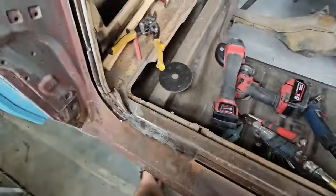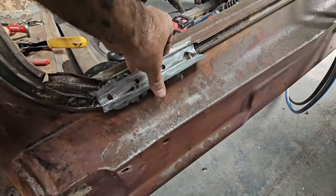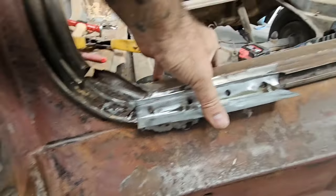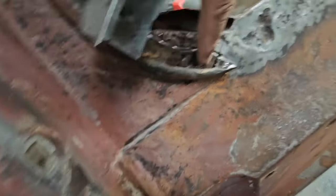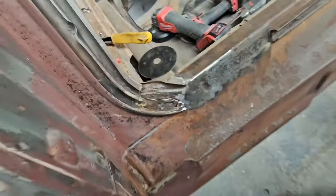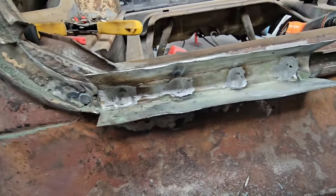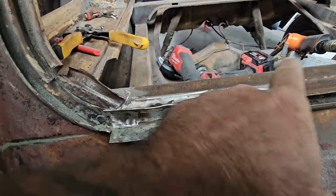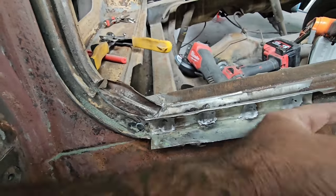Back on this side now. I've got this one set up to where I want it - drilled some holes so I'm going to spot weld it in and then get up to that part there. I've ground all my spot welds back and penetrated straight through - it's looking pretty good. Next I'm just going to start shaping this section and this section to match this section, then I'll trim it.